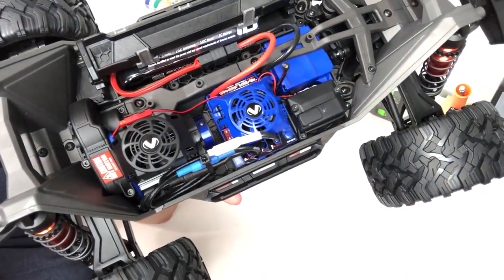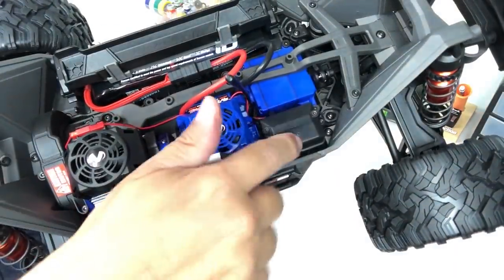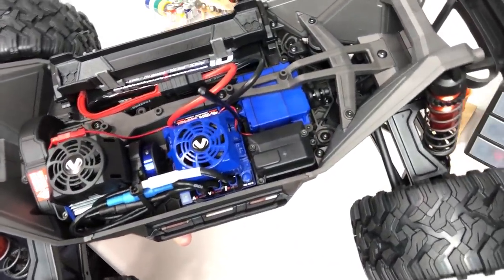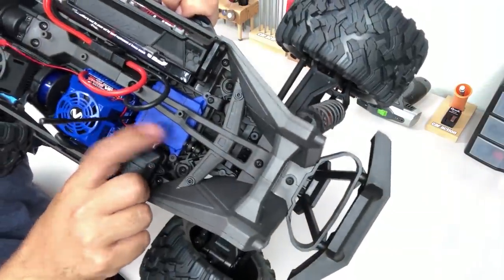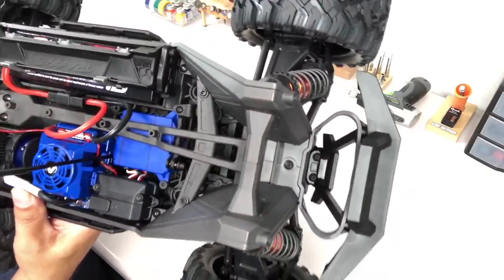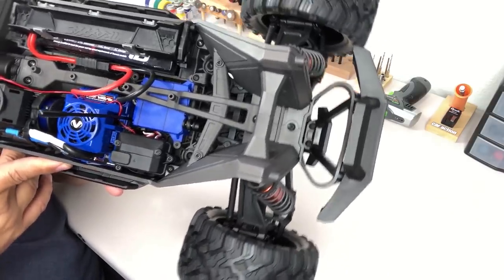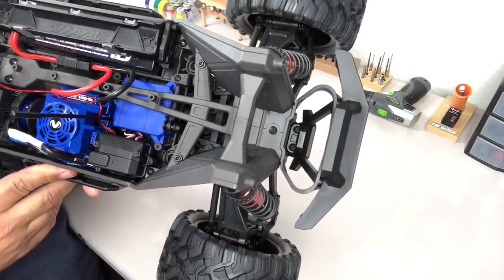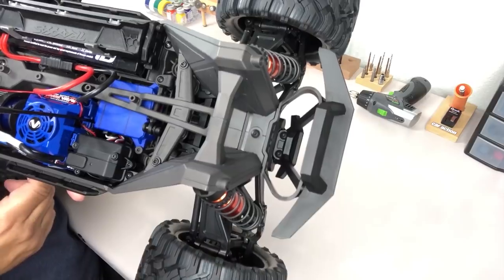It's a 4-pole 2200 kV motor with a 5-millimeter output shaft — rugged stuff for the Max. You have a waterproof receiver box with a TSM-equipped receiver, so you have Traxxas stability management to help put down that 4S power. The servo is the same style as what's in the X-Max — not the same model, but the same configuration — a 285-ounce servo. With that extra big case, you've got plenty of room for larger gears and a big motor to deliver all that torque, and plenty of durability since that servo is definitely taking some loads moving those big tires at speed. The linkages are held in double shear, captured on each side, so they're not going to pop off in a crash or an impact.